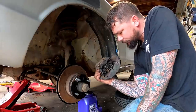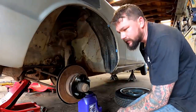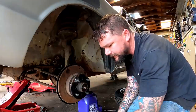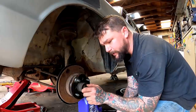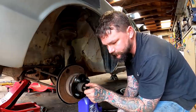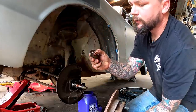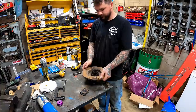Now, if your goal was to change the world's smallest brake pads, you'd be in business. But since we're gonna slap us a new rotor on this puppy, well, we need to pop this dust cap. I really wish we just had new rubber hoses for this thing. See there? You don't want those babies smoked, but damn, you don't want them with no preload at all on those bearings. So, pull that nut. There's our old washer and our outside bearing. Pull those puppies.